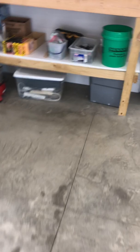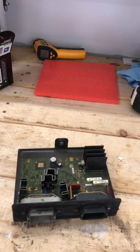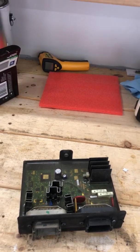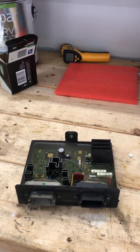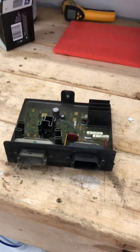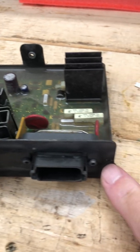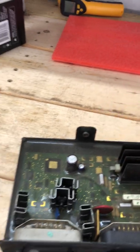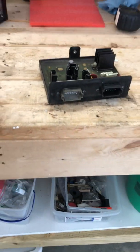It's really not that hard of a job to pull it out. I'm going to show you my old processor that came out of it. I think the problem was — when I pushed the start button it wouldn't do anything. I did the error code, which you get by touching the bottom part of the stuck start button — it flashes four and then two, giving you error code 42. The reason this failed is right here: two screws that weren't in there.